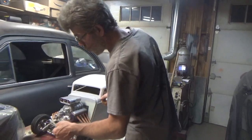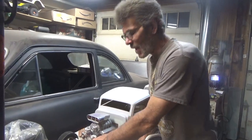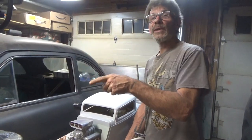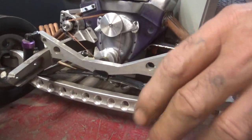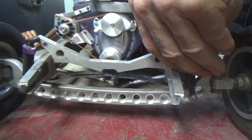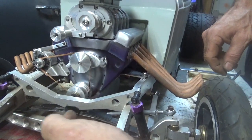I made new leaf springs — they were just 18 gauge sheet metal and I thought I could heat them and quench them and turn them into spring steel. Didn't work. I actually folded one in half and threw it in the trash because I replaced it. What I took — and I've got a piece of spring steel in between the other two — I do have shackles.